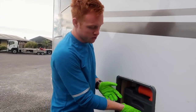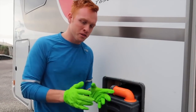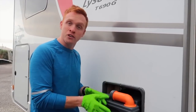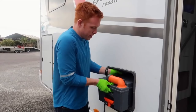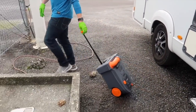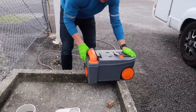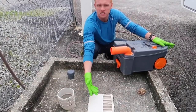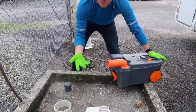The first thing I noticed is that the cassette toilet tucks into this compartment and is a lot more invasive into daily life than a normal toilet was in the US. In America, we had a standard black tank — you hook up your big sewer hose and don't actually have to look at anything. With the cassette toilet you're much more intimate with the tank. To dump the cassette, you pull up this lever, bring it out, and there's a handle to carry it. You flip it into the dump station pretty quickly, otherwise a mess will occur. After dumping, I take a water hose, rinse it out, shake it a couple times to help with the smell and get anything that's left, then slide it back in and close everything up. Last thing: I go inside and squirt some toilet deodorant in the toilet so it swishes around as we drive and helps with the smell.